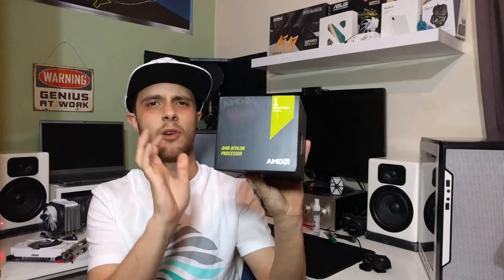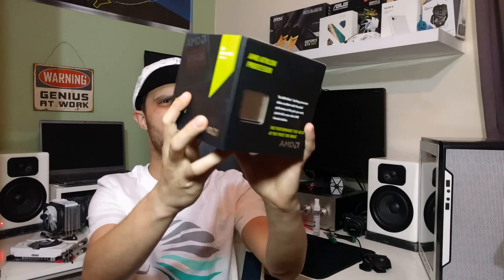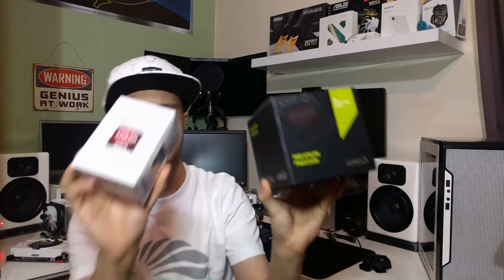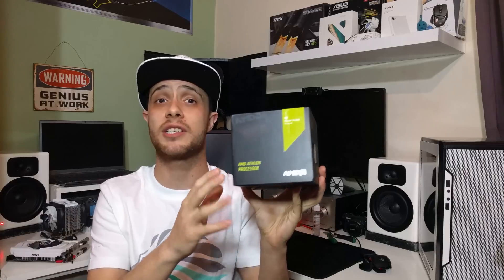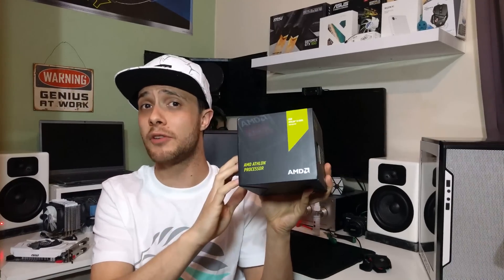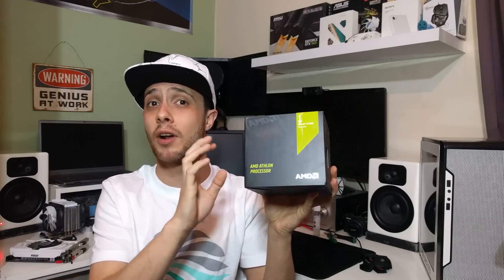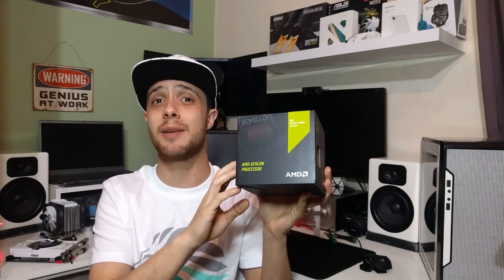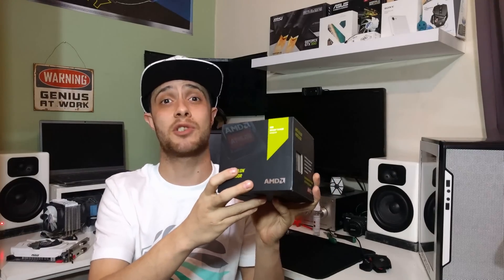Hi YouTube, I'm back with another video today. I have the AMD Athlon 880K unbox and I'm going to do an install as well. You might be thinking this isn't a massive box - well look at it, that's the 840. The box is bigger because it comes with a cut-down version of the Wraith cooler, which is rated at 125W TDP. Looking at some reviews of that Wraith cooler on an 8-core AMD processor running at 4GHz, it's managed to keep it at max 70°C - temperatures that are acceptable.